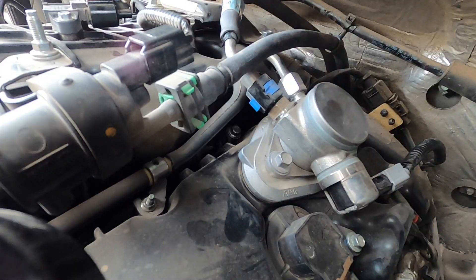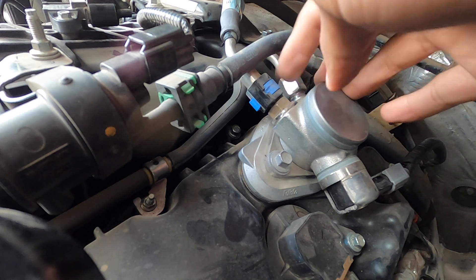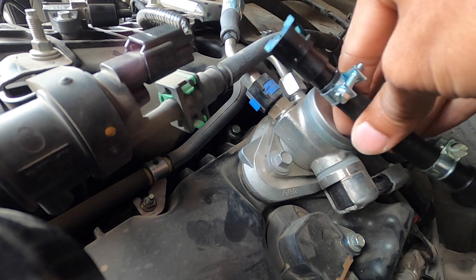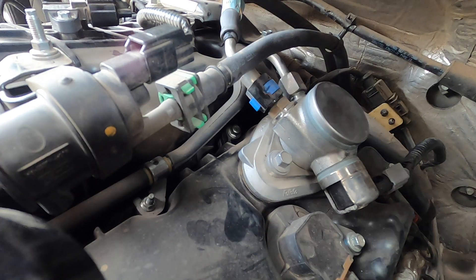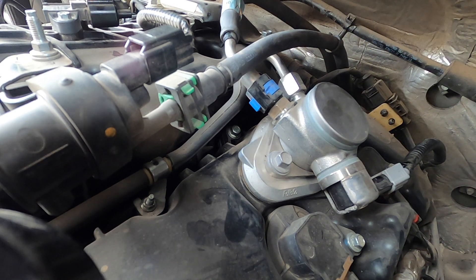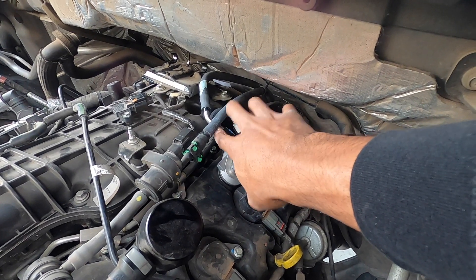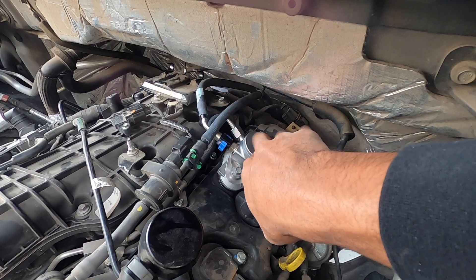Now for the fueling for real. The high pressure fuel pump is right here, and on the low side coming in there's a black and blue quick connect. With the adapter I made, coming from the high pressure fuel pump there's a 3/8 barb you connect with one side of the quick connect, then a little bit of hose in the middle, then another quick connect on this side that'll connect to the ethanol content sensor itself, and then the sensor mates back up with the existing quick connect on the fuel line. But first, you've got to get rid of the pressure in the fuel system — make sure to clean the area around the low pressure side with shop rags, maybe a little alcohol, and blow it down with an air hose to get as much dirt and dust away as possible.